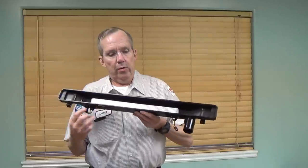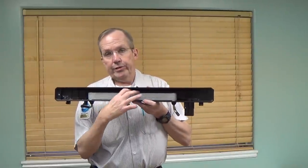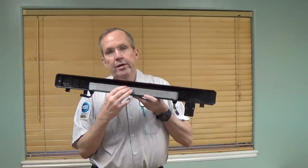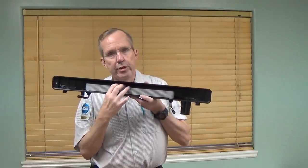So you have the classic Nissan radiator problem with the cross-contamination. Well, we have the fix for that. We have a custom-made radiator with a Honda Pilot tank in it, which is a heavy-duty. If you saw our other video and saw that lame design, this is much, much better.